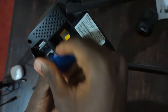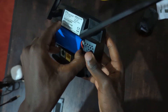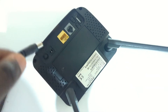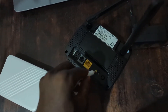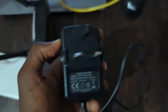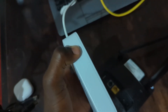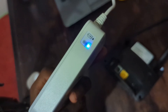But if you have just bought the router, simply insert the SIM card and then follow the next steps. We close this up, get our power adapter, insert it into the router, then we can power on from here. For those with power banks or UPS, insert the power bank into the power port on the router, then insert the power cable into the power bank, then insert the power plug into the socket. Don't forget to switch on the power bank — it should light up so you get power into the router.